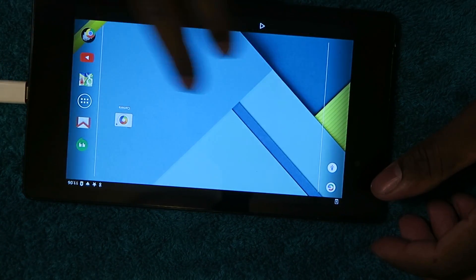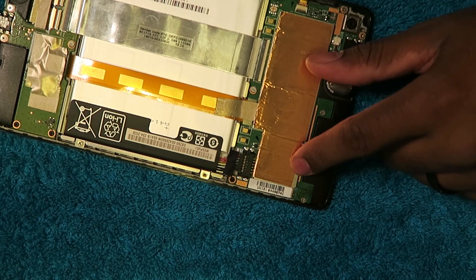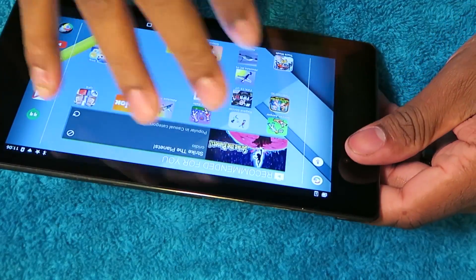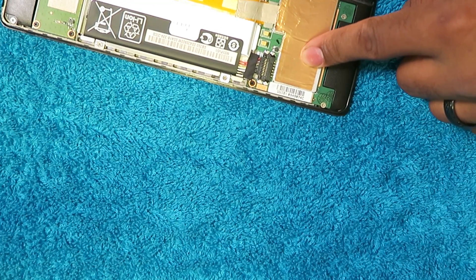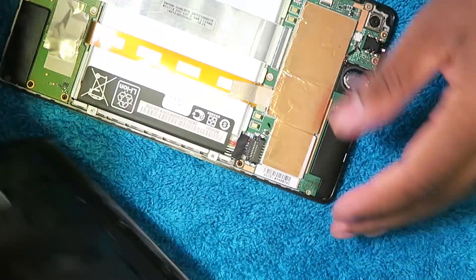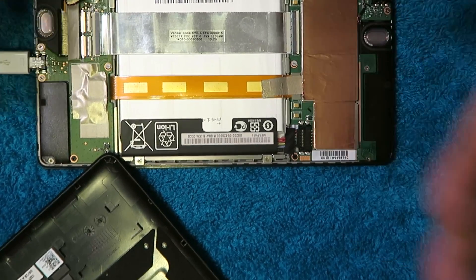This thing is back — it is back to working! I think what happened is that my son dropping the tablet somehow popped this ribbon connector out. When that popped out, it couldn't take input and couldn't communicate from one side of the motherboard to the other. This is clearly the brains of the device — there's some heat sink material and copper here to help dissipate heat, so the processor is over here but some input things are on the other side.